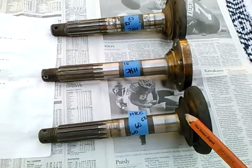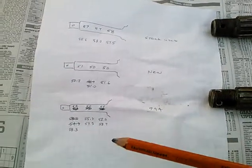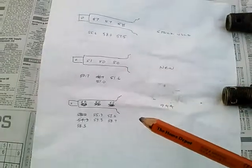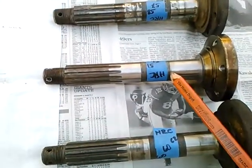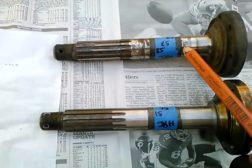While I had these three axles at my disposal, I had them hardness tested on two different hardness testing machines. And in both cases, while the numbers from machine to machine don't match, the agreement is complete that the Porsche axle is the hardest and the aftermarket is the softest, with the VW axle being in the middle.